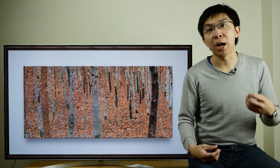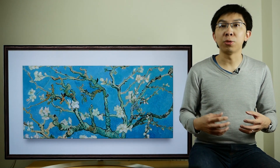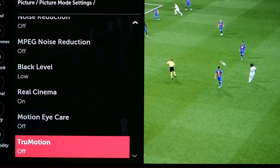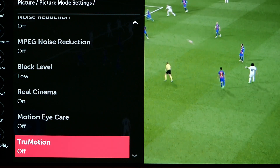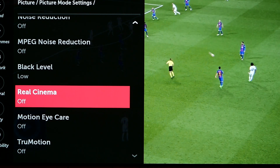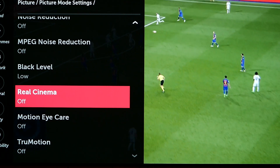When we watched some football in 1080i on the LG B7, we were surprised to see some repeatable deinterlacing artifacts during slower passages of play, even with True Motion disabled. I've captured it on video, but due to compression it's going to be very difficult to see in real time, so I'm going to slow down the relevant part. Here's the first instance with True Motion set to off — the ball is floating in the air... and the ball splits into three, with one artifact appearing in front and another appearing behind. We also checked the same footage with True Motion off and Real Cinema off — the same deinterlacing artifact appears.